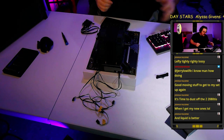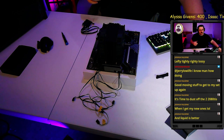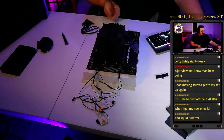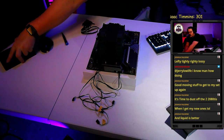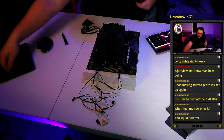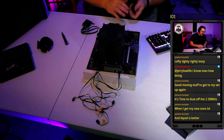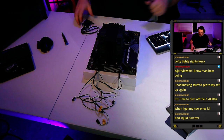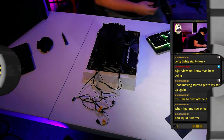This is basically a whole computer now. If you have a CPU with video output — like Intel or Ryzen 3000/5000 series ending in 'G' — you could plug this in and boot it as-is. This Ryzen 7 3700X does not have video output, so we still need a graphics card. But first we'll install this assembly into the case.